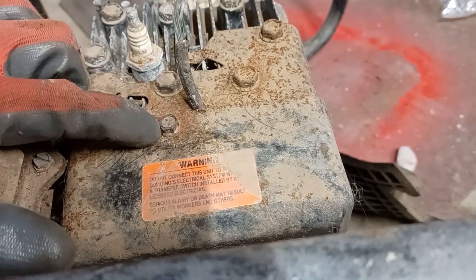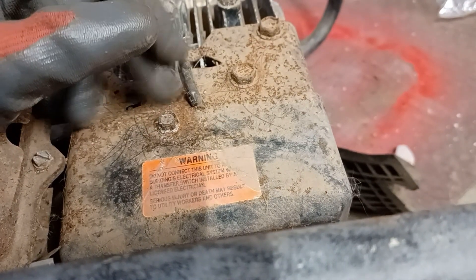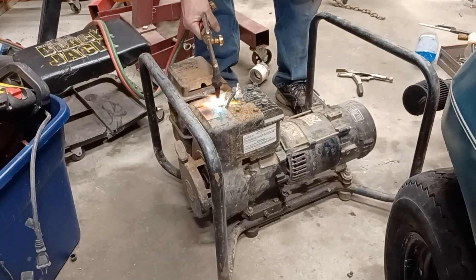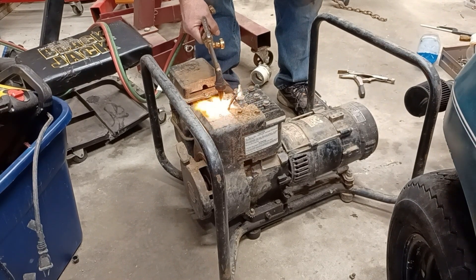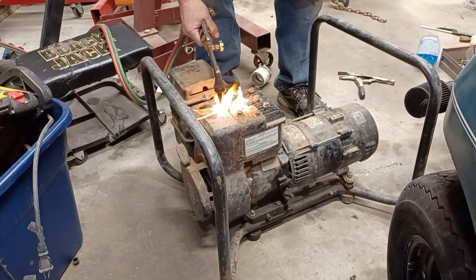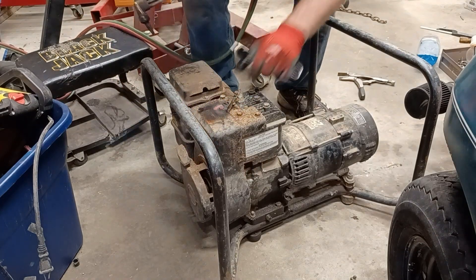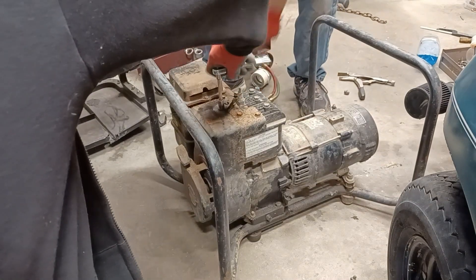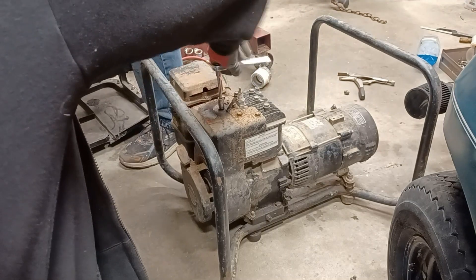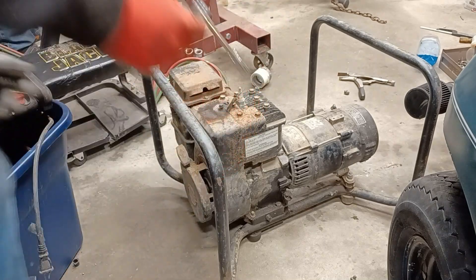It's not bad overall, but this bolt was actually frozen pretty bad so we had to pull out the torch. I could not get it to turn with all my strength. My dad was already using the torch cutting out a plate for the golf cart — wait for that video, it's coming soon. He heated it up for me and then I went over and broke it loose — breaks right loose. All it needs is a little bit of heat. Anybody dealing with rusted stuck stuff, a little bit of heat can help you a long ways.